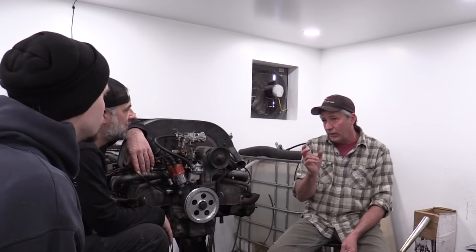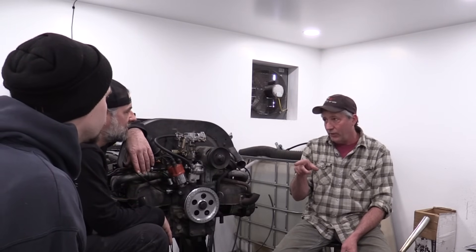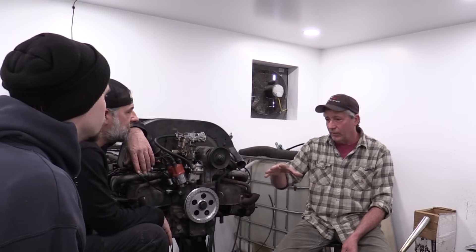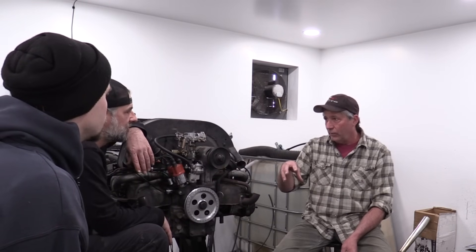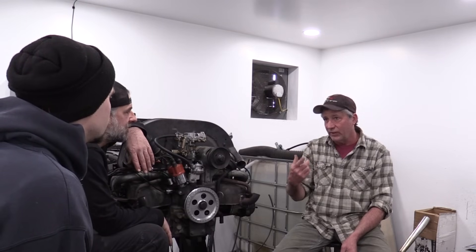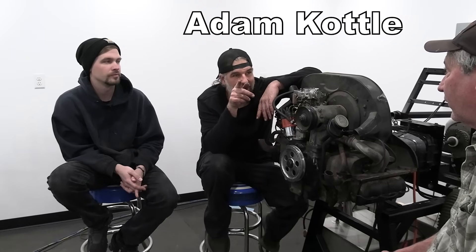How does it work like that? We tested a bunch of different exhausts in that video, looking at where each pipe came into the collector differently. What configuration do you need to get that scavenging? Is it just all four coming in at once? The firing order is 1, 4, 3, 2. If you look at a lot of Volkswagen headers designed for air-cooled VW, the piping comes together in firing order.